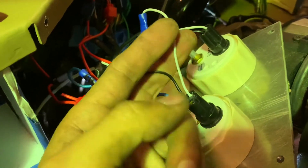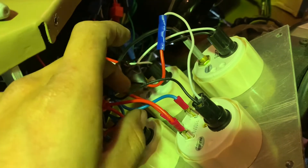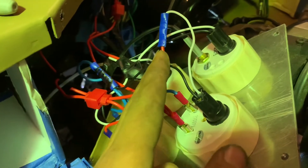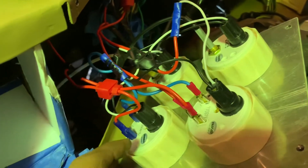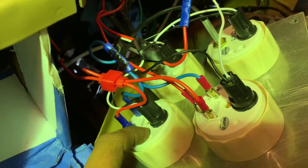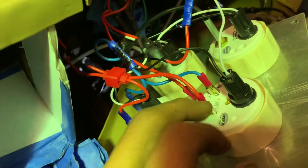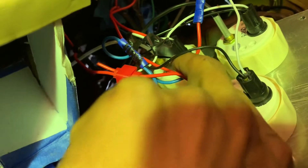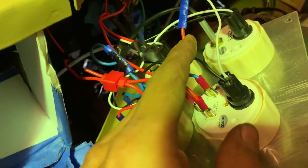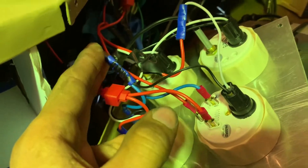For the illumination, the white wire was the power — you can tell by the red and all the other ones. I connected the ground, and believe it or not, instead of making more splices, the ground I needed for the voltage — that blue one right there — I hooked it up with the negative on the fuel gauge. Then I hooked up the ground for the illumination to one big single ground that goes to all the other grounds.